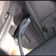I've installed the socket over the oxygen sensor, and as you can see, the wire comes out the side. This is going to allow you to get a little bit of torque on this to get this off. These things can be a little bit stubborn at times. What I suggest doing is heat up the engine for about 2 or 3 minutes and go ahead and spray some WD-40 on the oxygen sensor itself. Okay, we're ready to take off the oxygen sensor. Once you get it started, it should be rather easy to get off after that point.